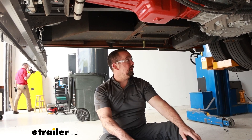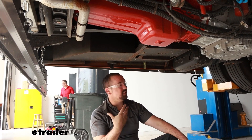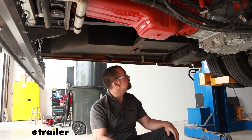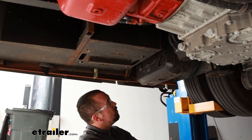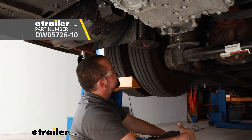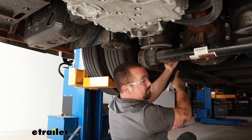Running our airline up, the main thing is to follow along the frame rail. You're going to want to stay away from anything hot or anything that could cause damage, and also chafing — something to keep an eye on. If there are any sharp corners, just make sure that the airline is not going to rub against it long term. I followed my frame rail and along the way threw a few zip ties up on some of the factory wire loom to keep it secure, tucked it up, and made my way back.